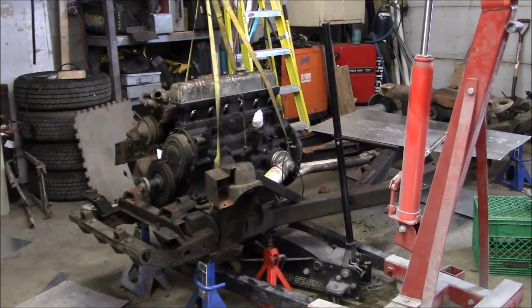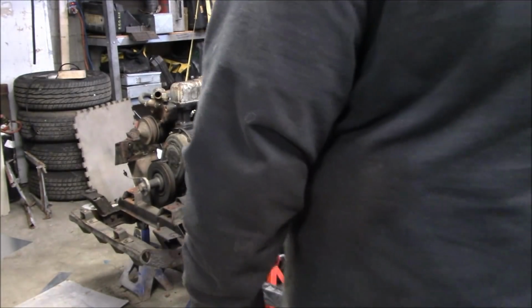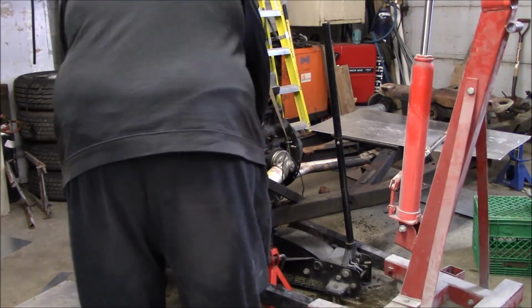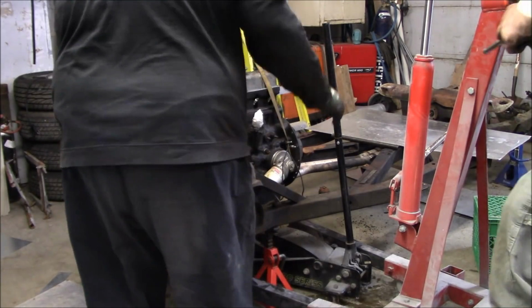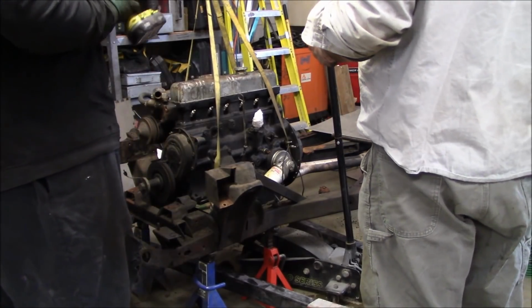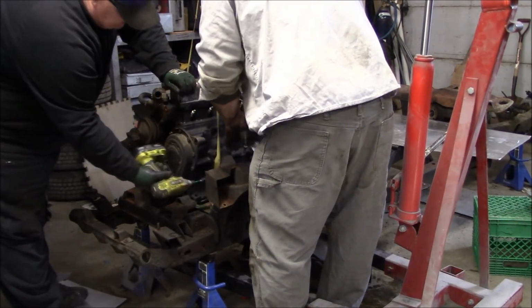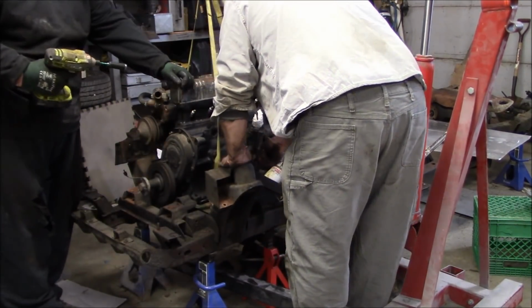Okay, we've got the engine straps on and hooked up. So we're just about to undo the motor mounts. Les will give me a wrench here. I thought we were going to use the impact. You're going to hold the one and I'm going to use the impact. Okay. Checking the size. 9/16. Perfect. Good. It's got a 9/16 in it. This may not work anyway. You might have to turn it. Top or bottom? Got to get an extension.